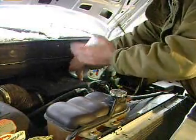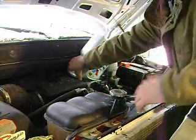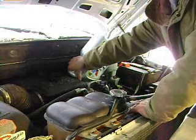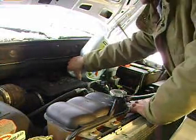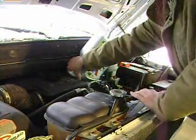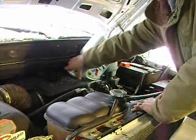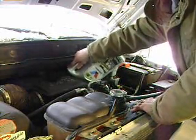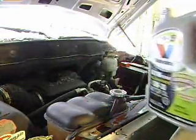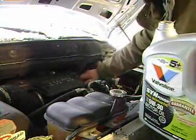We've drained the old oil, replaced the filter, put in a new filter, and now we just put in new oil. So button this all back up and go start your car. What I normally do is let it sit there and idle for like a minute or something, just to make sure the new oil gets through the system, because you don't want to put it in drive right away and starve the engine of oil if it hasn't gotten to any parts of the motor yet. And then that's it. You're done. And hopefully you did a good job.